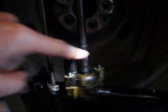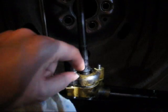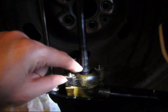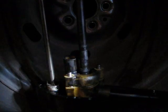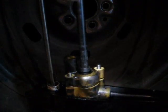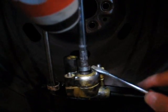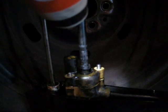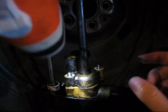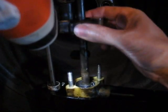I've taken off these two bolts right here. This right here is sort of a key and you want to pay attention to that, because it is actually a rubber O-ring that slides down, and if you don't move that up first, you're not going to be able to get that housing off. But the rest of it comes out pretty easy. You can move it up too.